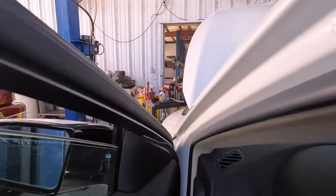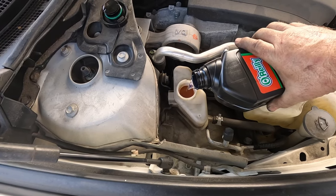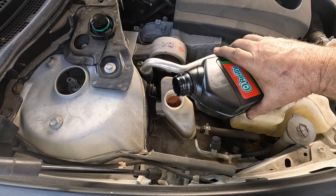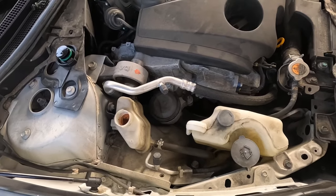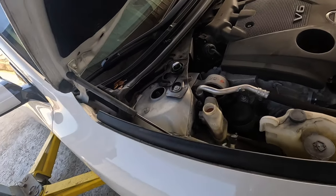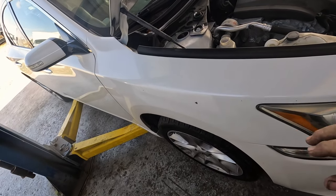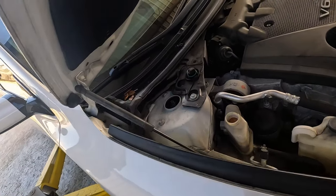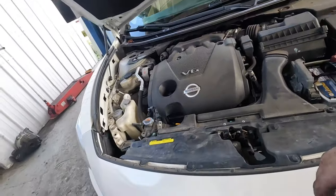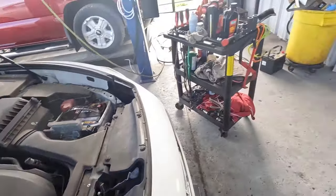Push to start — it's going to want more fluid. We'll let that stew a little while as I work the wheel back and forth, and we'll check the fluid level. It may take a couple of times to get all the air out. A lot of times on these you have to shut them off, let them sit a few minutes, then restart. We'll see how much we have to dance. All right — nice and quiet, got good power steering, no obvious leaks, fluid staying in there.